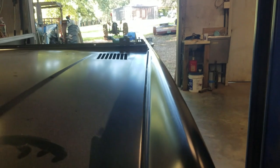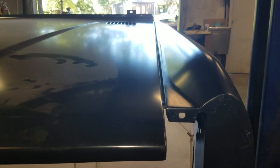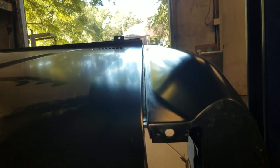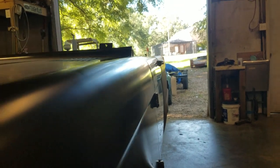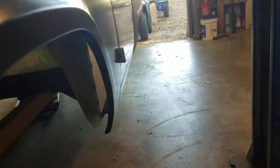Here's what I was talking about. When you first get your hood on, it gives you something to go by. Right now I've got my hood and my fender, and I've got a really nice gap. It's an eighth of an inch, maybe just a grunt more, all the way down to the door. If you look down my body lines you can see how it's fitting up next to the new door — the top is nice and straight. Coming down the side it's hitting the rocker real nice. So this is a real good start.